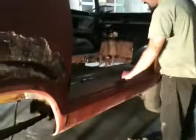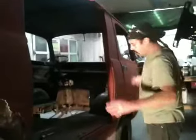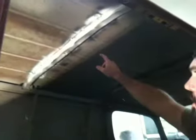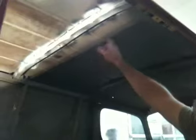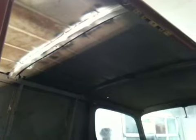This van is not in bad shape now that I'm starting to get into it. It's only been about a week since I started working on it, but you're going to see how fast things go — this thing is going to be amazing. Looking at the roof, there's white spot weld primer up there. Somebody spot-welded the main supports to the roof and actually buckled it, so I've got to go back and cut those all out. We'll get to that in the next video. Have a good day — go Vanners, thank you!